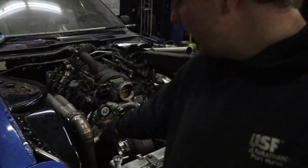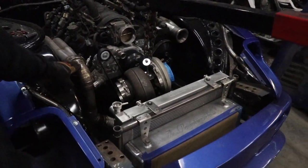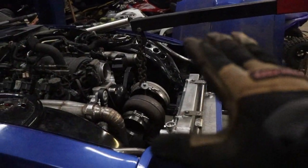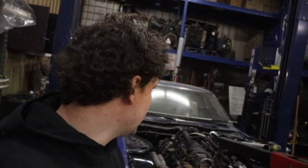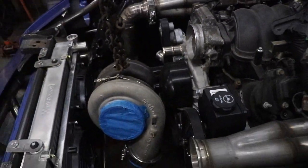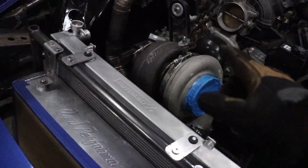I just got the passenger side all welded up. I did that first because once it's welded it's going to warp and change the dynamics of the other side. You can see all the pie cuts welded and it has the flex joint bellow going in. I had the turbo on the cherry picker the whole time because the flex pipe will bend with just the weight of the turbo. It's pretty tight but there is room for the water pump and it's away from the plastic electric fans.